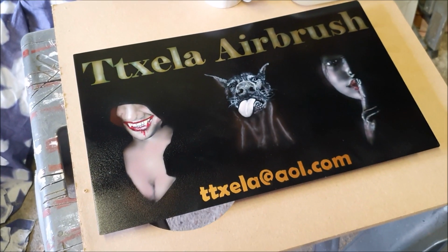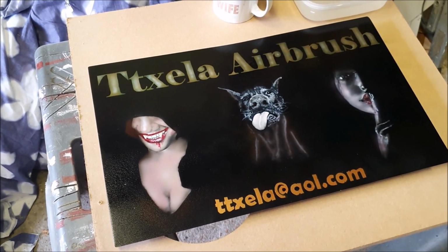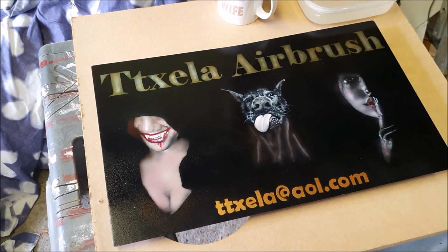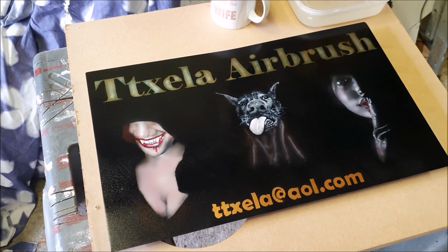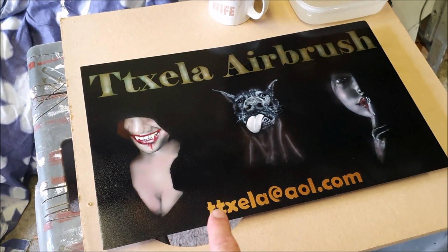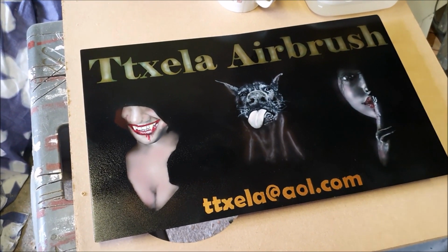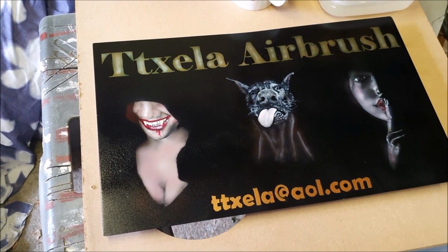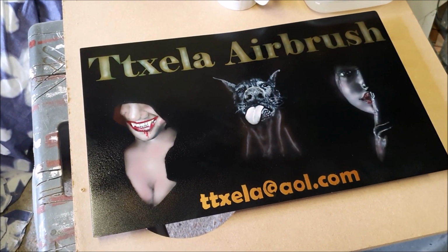It may need another coat of clear after that. I believe they call that a flow coat, as Mr Custom Airbrushing tells me. So we might need to do that. I don't know, we'll see how it turns out. The risk here, of course, is that you go too mad with the wet and dry and you actually start sanding off the design. So we need to watch that and not do that, hopefully.